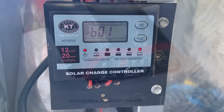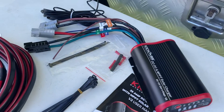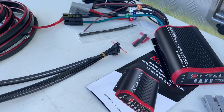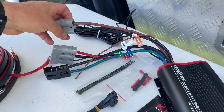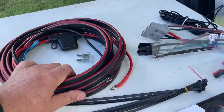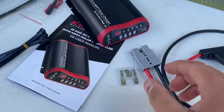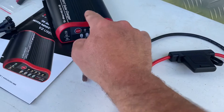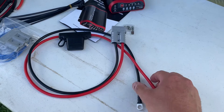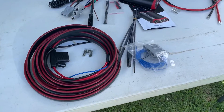What we're going to put in is something a little bit different. I've been watching these Kick-Ass DC-DC chargers for a very long time and thought this was the perfect opportunity. I'm currently on holidays in Queensland from Melbourne for a week and don't have all my tools with me, so this plug-and-play system is very good for what we're creating. We've got the pre-wiring kit with the new triple Anderson plug with ignition control, because we're going in a BT50 which has a smart alternator. We've got the DC-DC charger — the lithium-upgraded one — so in the future we can put a lithium battery in, plus the battery connecting kit.